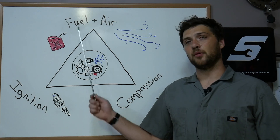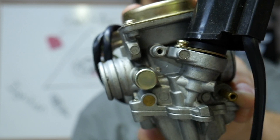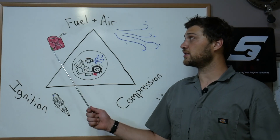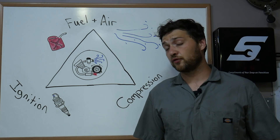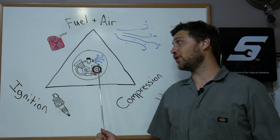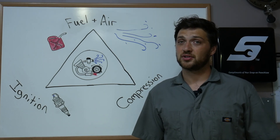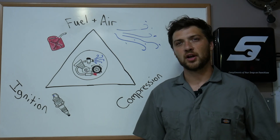The charge of fuel and air is supplied by your scooter's carburetor. A carburetor is a mechanical device that mixes a precise amount of fuel with a precise amount of air — this is called your fuel-to-air ratio. If the ratio is way off, the engine won't run. If it's close, the engine might run or might cough or sputter, but it won't run well.